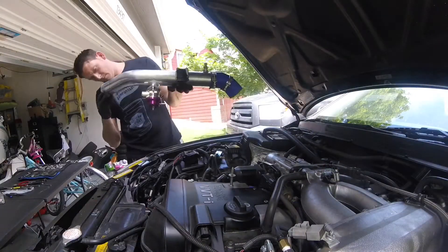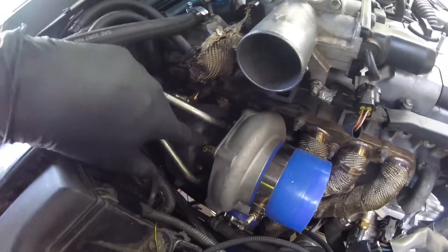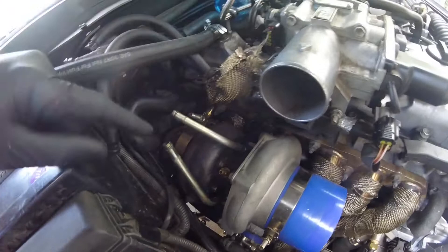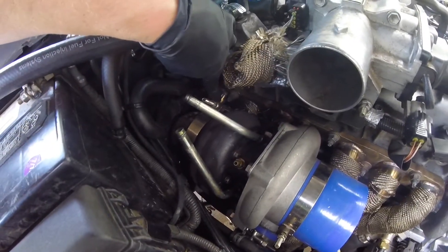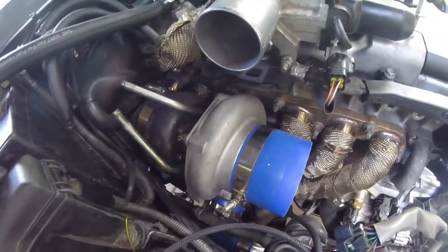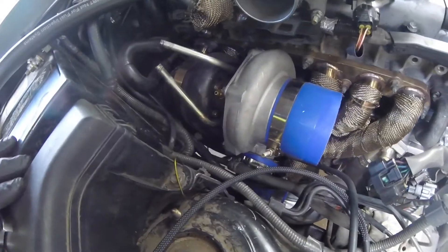So I know you've been here before, but I will take you back with me, maybe a little more in-depth look this time. The coolant line is disconnected and out of the way, with the oil feed line up and out of the way. I'm going to go ahead and loosen the downpipe up and down at the bottom, get that out of the way, and then we can start unbolting the turbo. I do also need to loosen that outlet there.